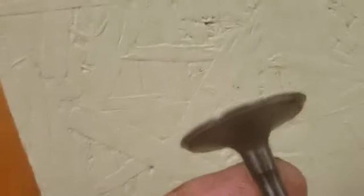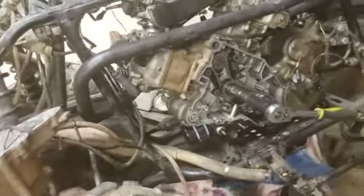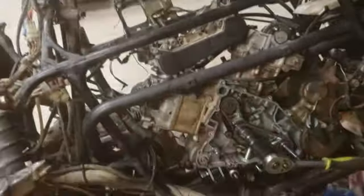See that little dimple? That was making it not work too. It kind of ran with that but not very good. It was good that I took it apart because I knew there was no compression in the front, so that was bad too. So this motor should have been ready to go — it was not even close.